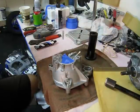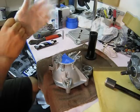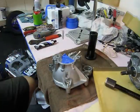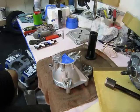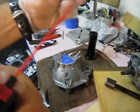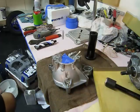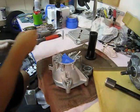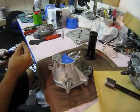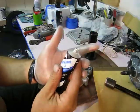We're going to apply a light coating of Honda Bond to the case half and get ready to pull the case halves together. We're going to put on a latex glove, clean off the glove one last time to get rid of any dust, and then we'll put the Honda Bond on the glove.